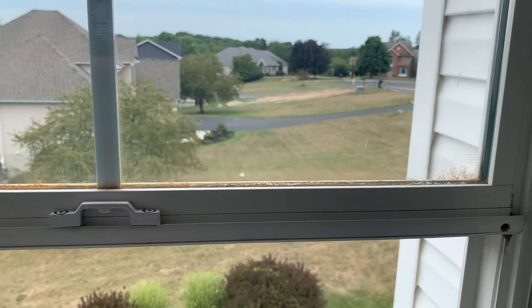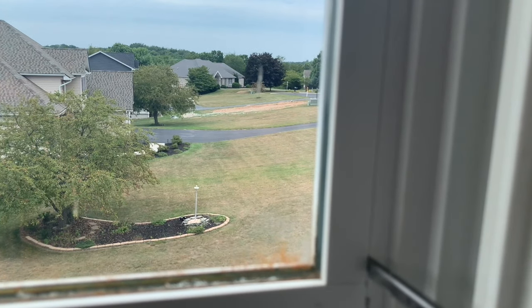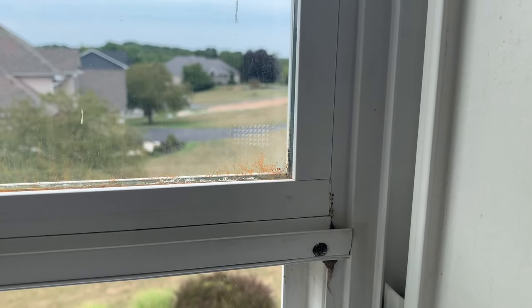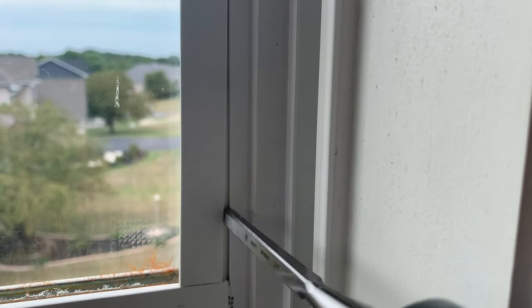Best way to do this - we're going to put a quarter-inch wood chisel right in that crack and then just twist, and this will start popping out of the track. Then I'll go ahead and pull it the rest of the way out. You really have to try not to damage this piece when you're twisting it. I do have extra pieces in case I need them.